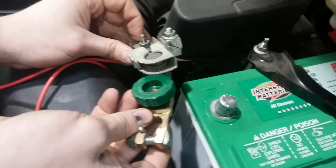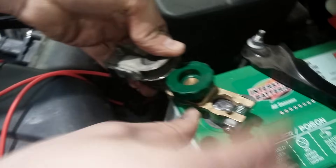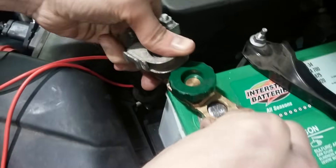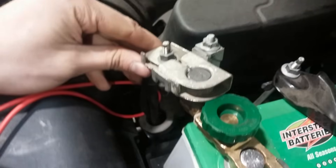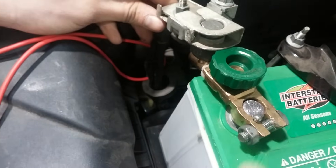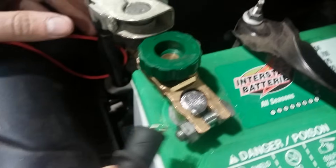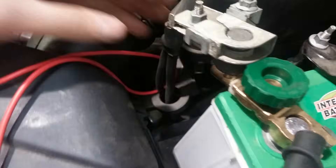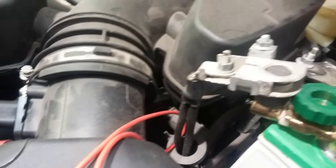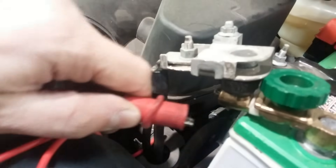The parasitic drain tool has a battery post on one end that connects onto the battery cable, and fits over onto the battery terminal on the other end. It has two small pins so you can connect your multimeter's alligator clips — one on the side connected to the battery terminal and one on the back side.